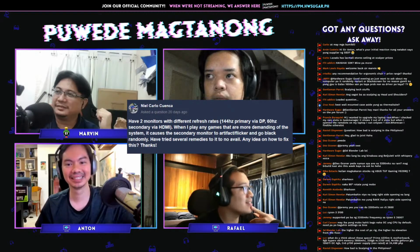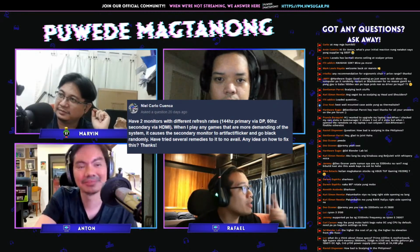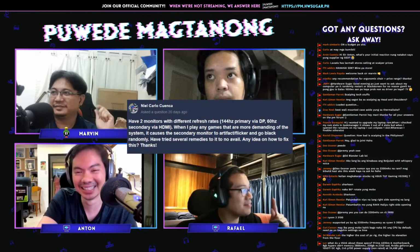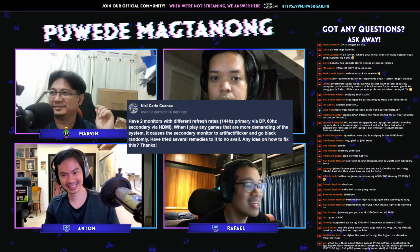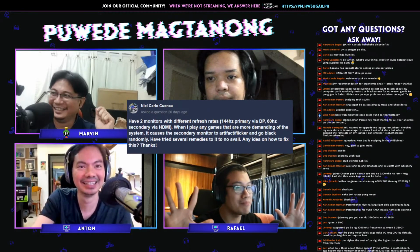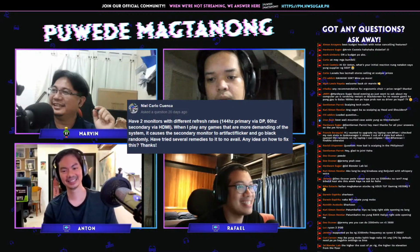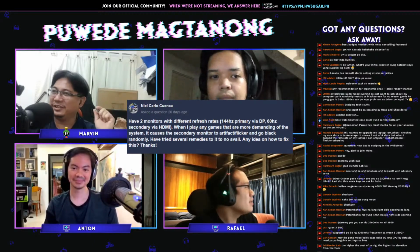Well, I am actually running 165 Hz primary through DisplayPort, and your secondary? No, but my secondary is DisplayPort also. At 60 Hz. Yeah, 60 Hz. Actually, the reason I used DisplayPort for my secondary is because if I use HDMI, it goes down to 50 Hz. And I can't stand that. Those extra 10 are super important. I thought I broke something, but apparently I needed to buy a DisplayPort cable. So I bought a DisplayPort cable, and it's back to normal. In fact, Samsung also says that if you want the full 60, you should use DisplayPort. So, anyway. That's a weird thing of Samsung.